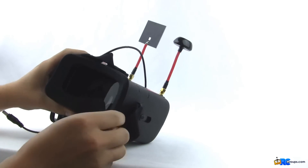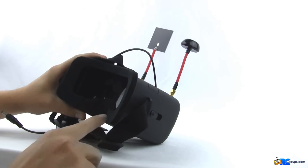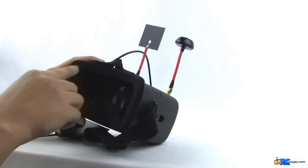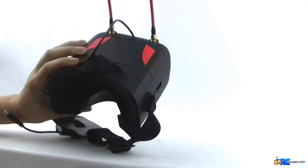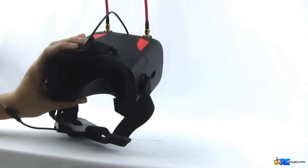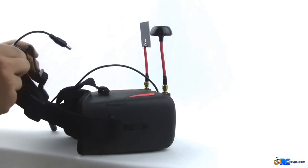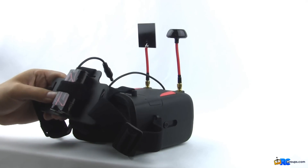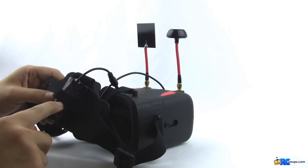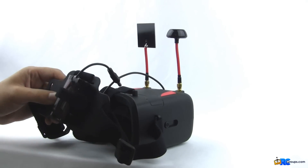As far as fit and comfort goes, it's okay — not great. There was a lot of light leakage around the sides, and a lot of weight being pressed on my cheekbones. I think another layer of foam would help with that — it's about a quarter to three-eighths of an inch foam right now. In the back you have adjustable straps and the battery, but the battery does tend to slide, so I'd suggest sticking a piece of fuzzy velcro on the battery itself to keep it secured in the battery strap.